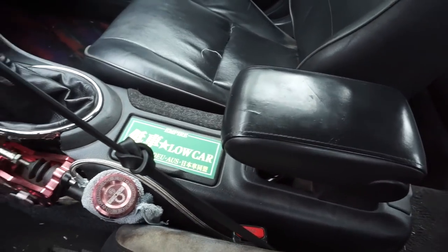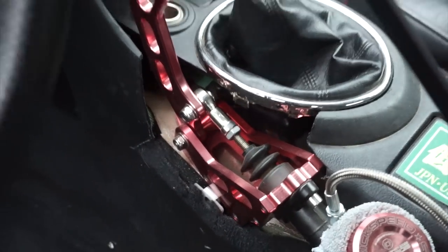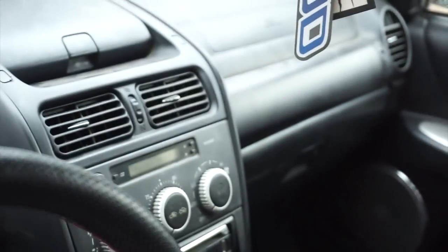He's gonna change out his whole center dash - he did cut that piece and wants to make it more clean to complete his whole O1 dash. Also, Dallas's car is still having problems charging the battery. The alternator is not working well, only putting out around six volts. He tried everything - new alternator, new battery - just doesn't know why it's not charging.